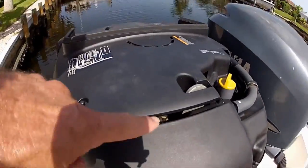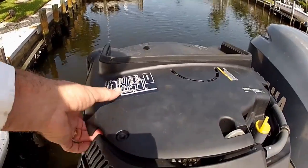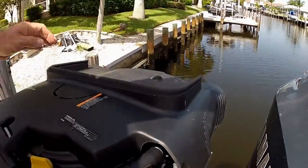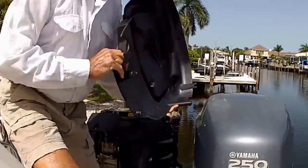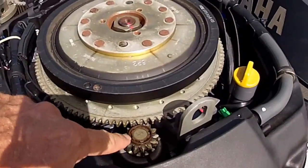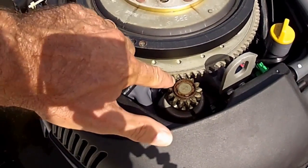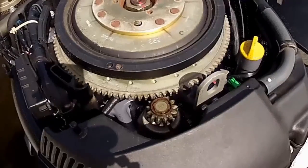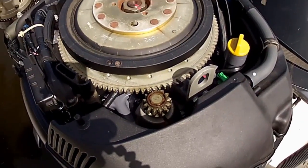So we take off the engine cover to get a good look at the starter right down in here. I'm going to have to take this little fancy cover off the top — it's just held on with about five rubber-mounted attachment points. Here I find the starter partially engaged yet never turned over. You can see how it's engaging the flywheel, but again we never heard the engine crank over. It's obviously a starting problem.